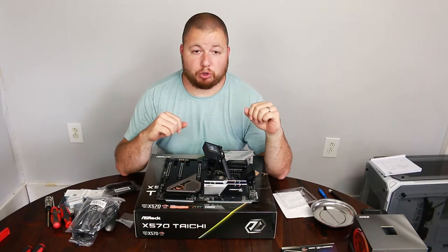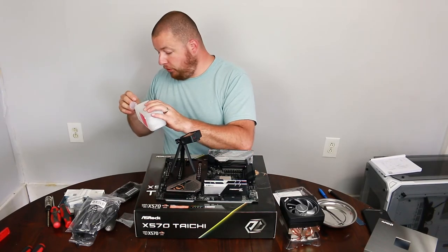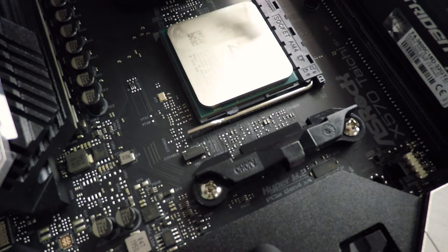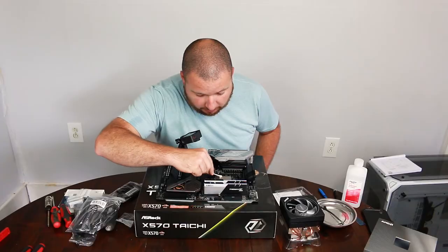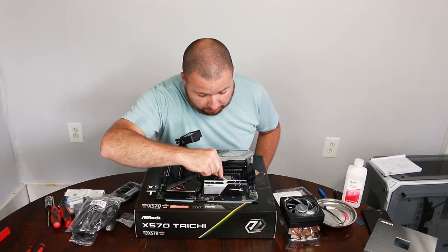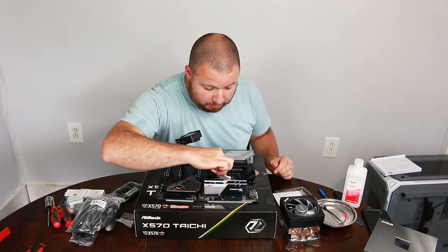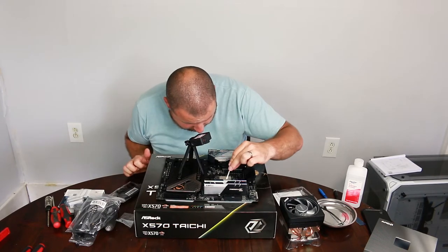our CPU cooler. Before we go ahead and put our cooler on, the first thing I'm gonna do is I just wanna clean up our CPU. Because we did put some finger oils on there from when we first installed it, and I don't want anything on there that could be detrimental to the thermal bridging. So we're just going to take some alcohol and just wipe off any oils that we may have on our CPU. Okay, that looks really good.